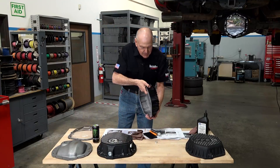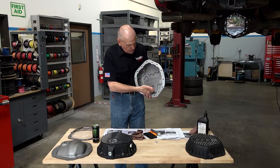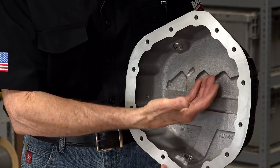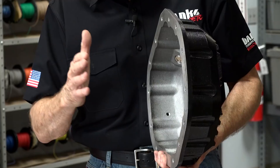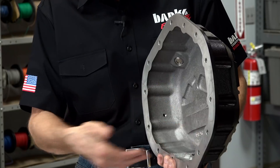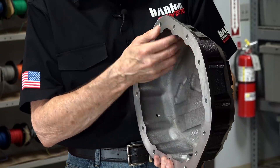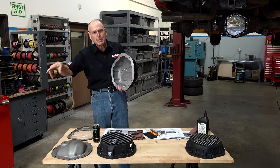Because you've got a really flat back. You're driving the fluid, I theorize, into this flat, up across any features that might be inside, dragging it, and then impacting the top. Will it spill off? What I'm curious about is what happens inside of one of these things with that square corner — impact there, drive it up to here, impact here. Does anything get to the ring and pinion interface? Does anything get to that front pinion bearing at all?